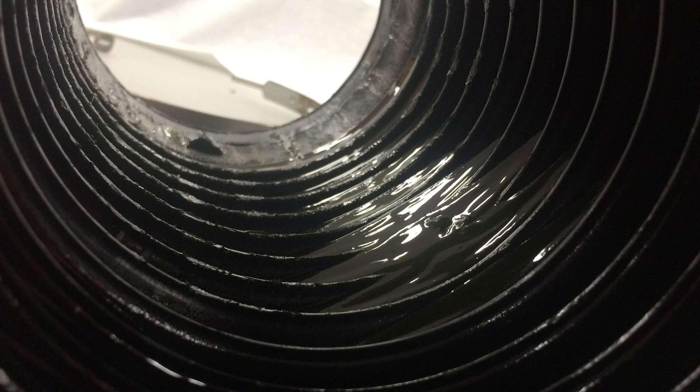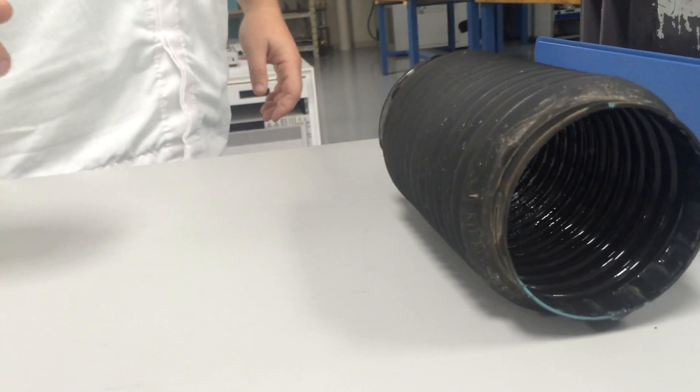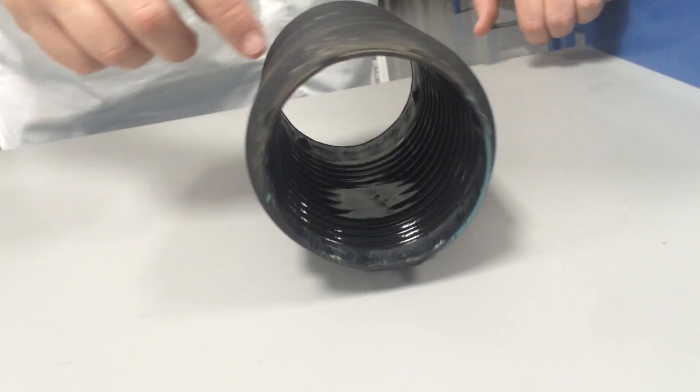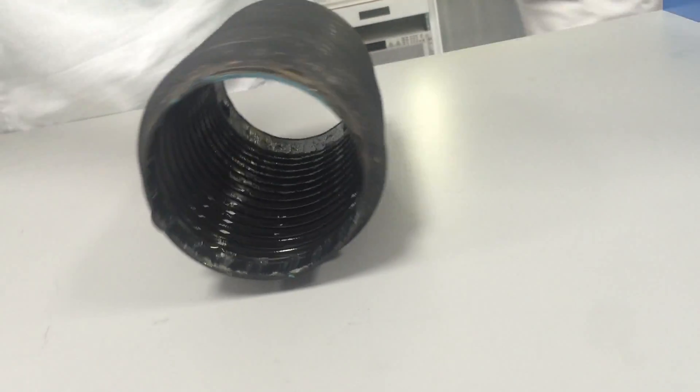This is a picture of the inside of the boot. You can see toward the right side on the bottom there's what looks like a puddle of grease. There was some grease in here that was liquid and still in good shape, but this puddle was pretty well stuck in that position. I'm going to show you a video of what happens to this puddle as we roll it around. Every single time we rolled the boot, that puddle of grease stayed right at the bottom — it was obviously throwing this boot out of balance.